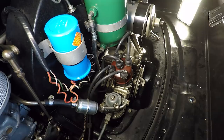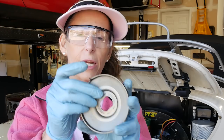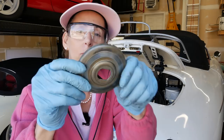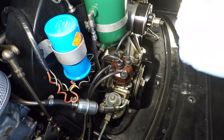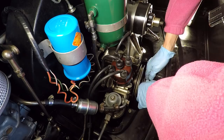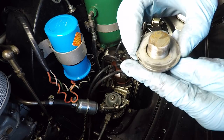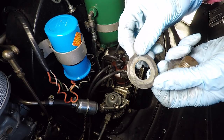The other thing I'm going to do is bang down these edges here — they're sharp and sticking up, and they shouldn't be. I'll bang those down and then hit it with a little file to smooth it out. That looks a bit better now. We can take the nut off the rest of the way. There's a big floppy washer here behind it. The bolt looks like somebody's ground the end off. The floppy washer looks to be in good shape — no splits or cracks — and the threads look good.